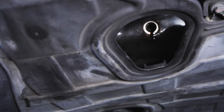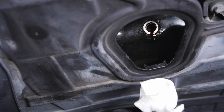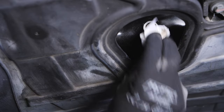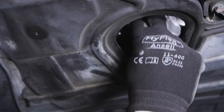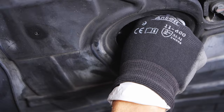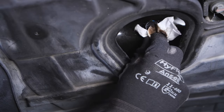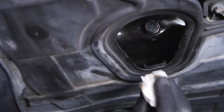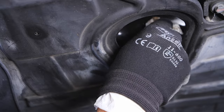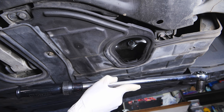Alright, so now we're back under the car and our oil is drained. We have our new clean bolt, but before we install the bolt let's clean up our oil pan where the oil was draining. We want to make sure that surface is nice and clean so no sand gets lodged between the crush washer and the pan, which could lead to leaks. One reason I'm so meticulous about cleaning when it comes to fluids is that when everything is clean, it lets you know if you have a leak.